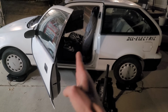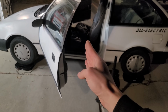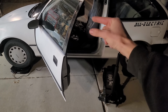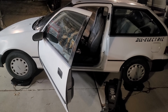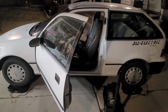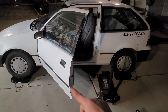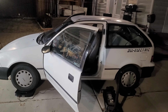Since the driver's seat is roughly in the middle, front and rear, I can assume that if I was put in there, that'd be 80 pounds added to the front, 80 to the rear, so I'd still be below both the axle ratings with me in the car. Add a passenger up front, and it gets close to exceeding the front weight. That probably exceeds it by a little bit, but I don't think that's that huge of a deal. I haven't seen any performance or handling issues with this car as is. If you put 4 people in there, you'd probably exceed both the front and rear weight ratings, but I don't think 4 people want to hop in a Geo Metro anyway, so that's beside the point.